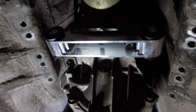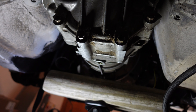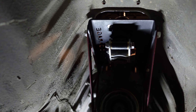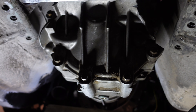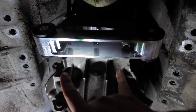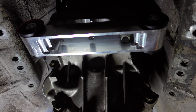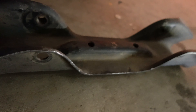It has been a little bit and I am just getting the transmission in the car. No issues with the transmission getting up in here. Obviously it's pretty heavy so it was a little difficult getting it in, but everything bolts up just fine. It is a taller transmission, so it has to sit a little bit lower. That bracket that I made for the shifter is really close to the top, so I went ahead and pushed it all the way up until it was touching, then lowered it about half an inch just to make sure nothing was going to hit. I realized that the bolt pattern for this bushing actually matches up with the spread of the original Z31 bushing. This is the aluminum bracket that I made a while ago, and when I put it on here it actually fits — just throwing that original crossmember bracket back on. So this is what I'm doing for mounting.